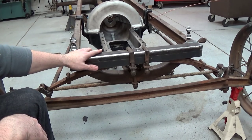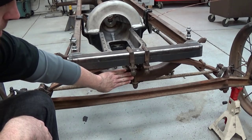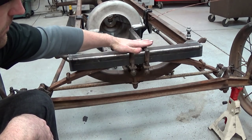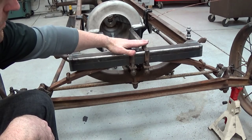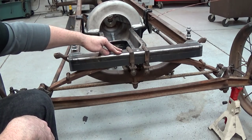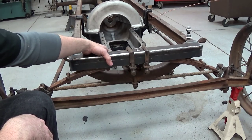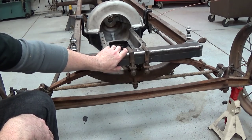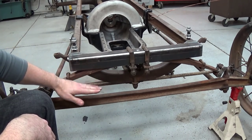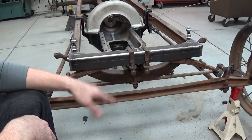We made a front cross member — there are lots of different ways to do this, this is just the one I picked. A lot of times you'll see a large plate that comes up and makes a bracket, usually quarter-inch thick, with some kind of U-bolt to hold the spring. What we did is made a piece that goes from frame rail to frame rail, straight horizontal, and the spring fits up in the channel just like on the original frame. Done this way, it's basically a five-inch drop, measuring from surface to surface.